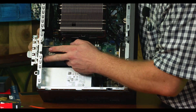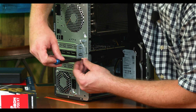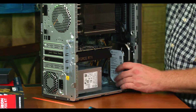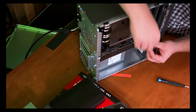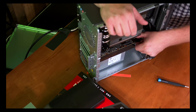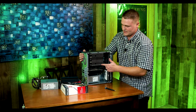Go ahead and close your door — we're going to put that screw in right away because this is what holds the graphics card. There are no retaining screws like on other PCs to actually hold the graphics card in, so you might have to kind of shut that door and get that screw in. Then we are going to the 8-pin power right here. We want to find our 8-pin power cable — it's actually a 6-plus-2 — merge the cable together, and the latch goes towards the bottom with this graphics card. Make sure it snaps and make sure you don't see any gap there, which means you're fully seated.